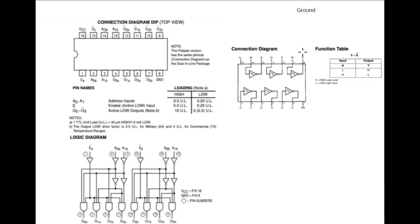I did my research on what would happen if I did this little fix to the modification on the MC10 motherboard, and I came to the conclusion that one of two things will happen — either this should fix the interference problem, or it'll cause a cascading event that'll completely destroy reality as we know it. But seriously, I looked into exactly what would happen. It turns out that pin 8 on U12 sends either a high or low signal to pin 15 of the piggyback chip on U5. The changing of the input between high and low to pin 15 affects the outputs of pins 9, 10, 11, and 12. By disconnecting the wire and attaching it to ground, you are fixing pin 15 to a low input.